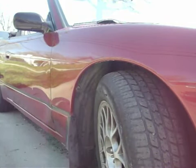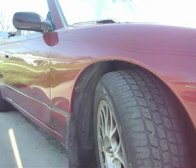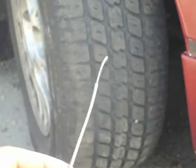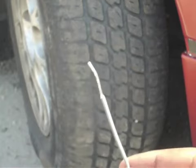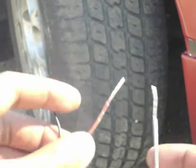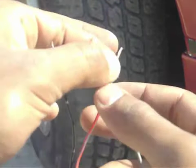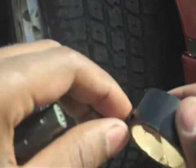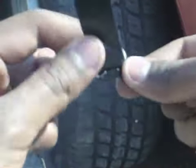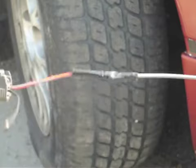Since we're already down here, we're going to go ahead and strip some of the other wire we got and prep that to be connected so you don't have to do it later. Now that you have your wires all ready, you're going to take one of the wires you cut and twist it or splice it with the red wire from the original harness. When you're finished doing that, you're going to want to wrap it with some electrical tape or heat shrink, whatever you have. This is what you should get when you finish taping it — nothing really complicated.